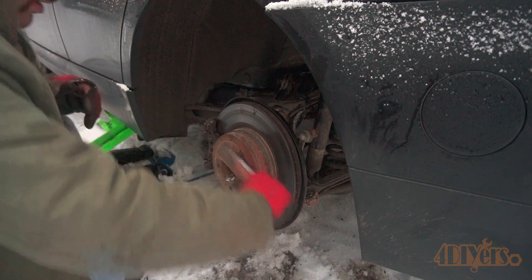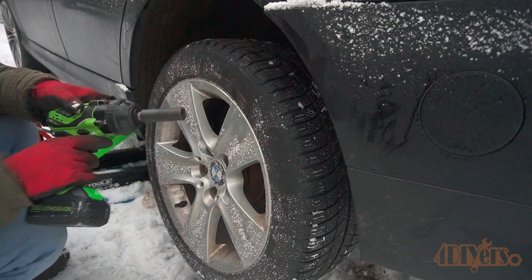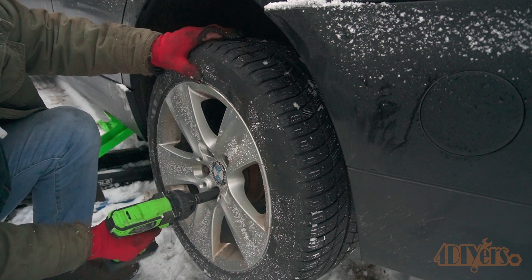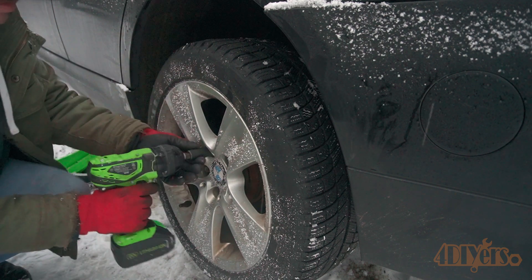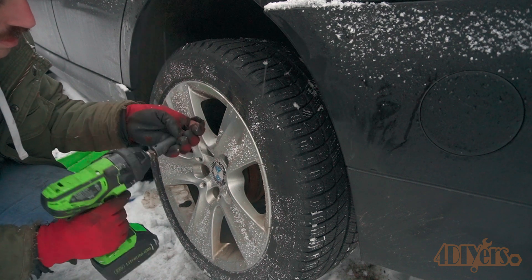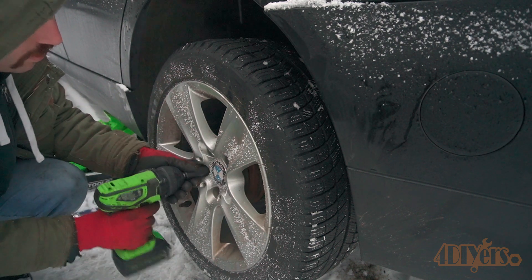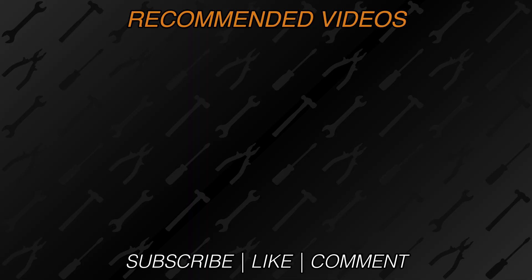Clean the hub mounting surface on the car and then the back side of the wheel, then install the wheel. The torque specification for the lug studs is 88 foot-pounds or 119 newton meters. New videos are released every week on my channel — be sure to hit the thumbs up button, it's a huge help. Leave a comment below if you found this tutorial helpful, and if you're not a subscriber, be sure to hit the subscribe button. Thank you for watching.